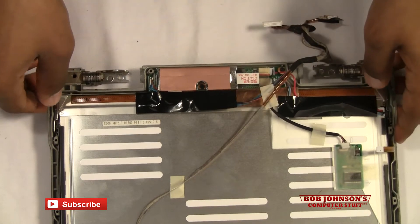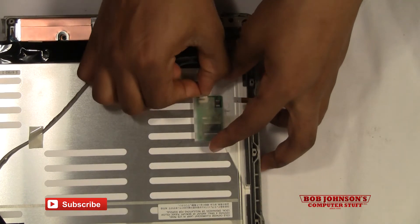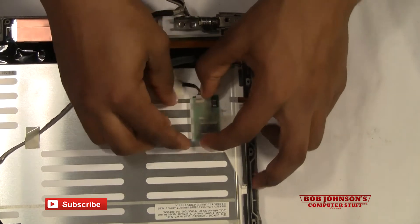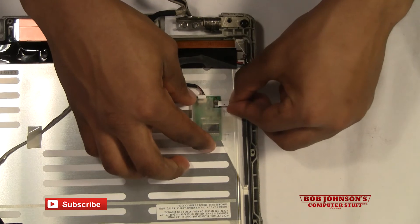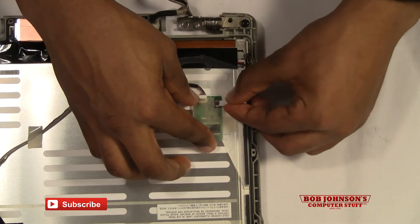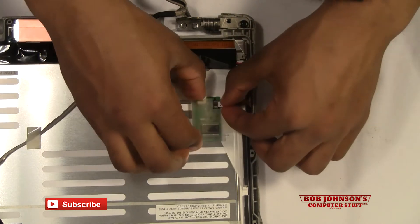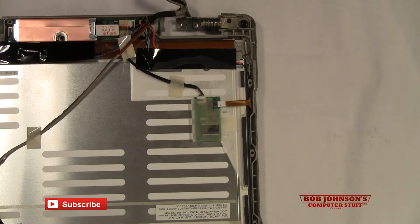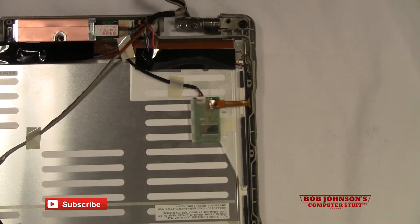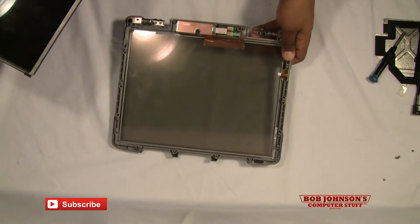Now that will replace all the wires — we also have to reconnect the touch screen. This wire goes in like so, and then I want to replace this ribbon cable here as well. Once you've replaced all the wires and they're firmly secure into the connectors, there's also a piece of tape that goes over this ribbon cable, so we'll just replace that like so.